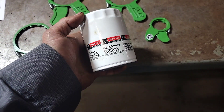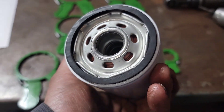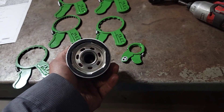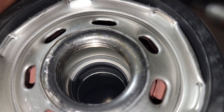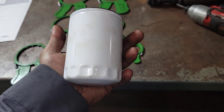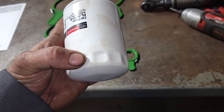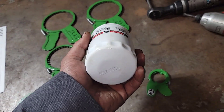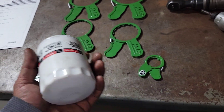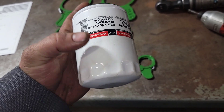We are changing the oil on a 2015 Ford F-150 3.5-liter EcoBoost. This is an FL-500 standard filter made by Purolator for Ford. The bypass is in the top — it's one of the better OE-side filters, 99% efficient at a 30-micron rating. The bypass is up here between the two black O-rings instead of in the bottom. On cold starts every filter will bypass without filtering until it warms up, meaning sediment stays in the bottom rather than washing up through the center like with Frams or other filters that have the bypass in the bottom.